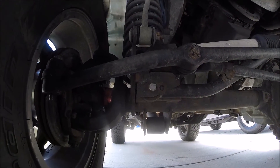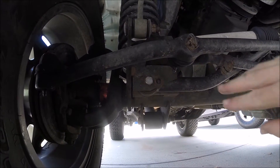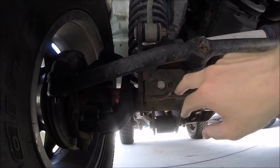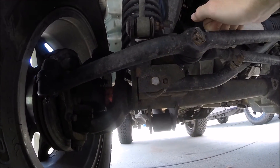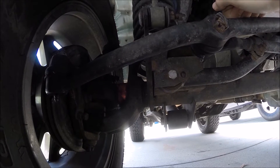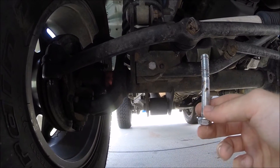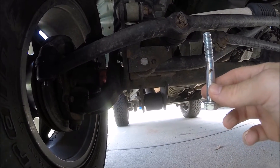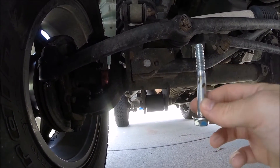So back to the drawing board. The correct way to fix this would be to get a plate of steel, weld it over there, and drill new holes through it. But if you don't have a welder available or easy access to one, what I did was go to the auto parts store, taking the larger upgraded bolt with me, and buying one size bigger.